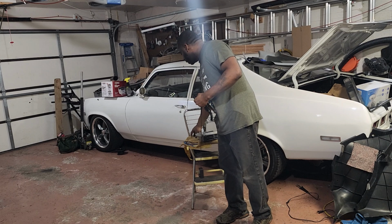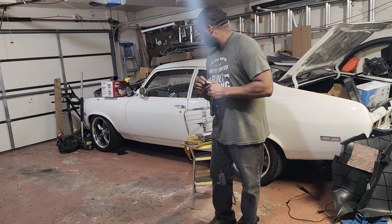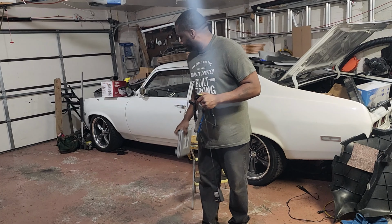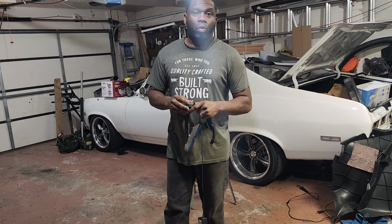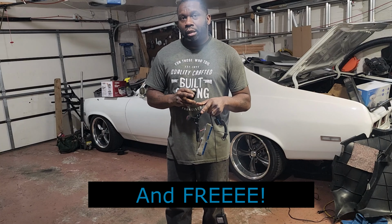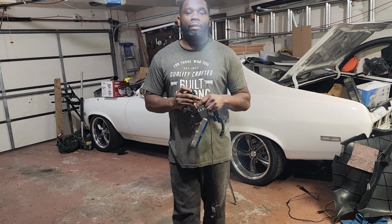Next up, you're going to need obviously your dongle, just like for episode 1, and obviously your PCM. We're also going to use a couple of programs that were covered in episode 1, called PCM Hammer as well as Universal Patcher. Both of these programs are needed to actually do the segment swap to get you up and running.